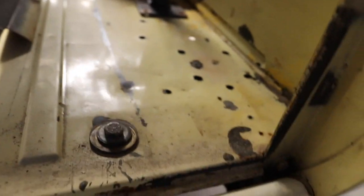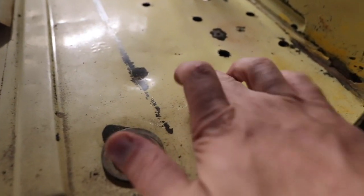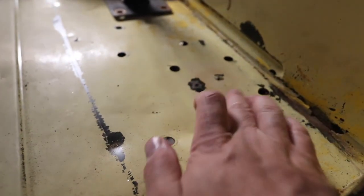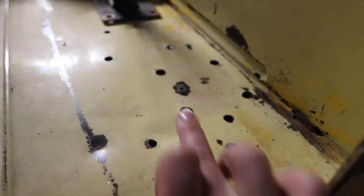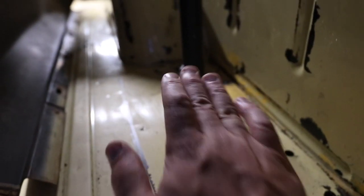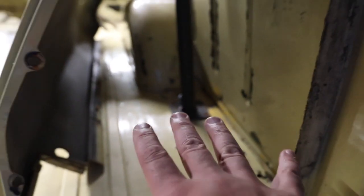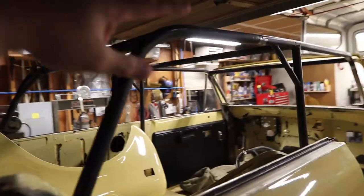You can see, first of all, where this is just totally, that's what I'm talking about. This was the plate. This was the plate holes, these 4, and then you can see where the corner of the plate was just digging into the metal. And this is a no man's land of support. So I'm going to push this up to the wheel well, which is a much better supported area of the bed.